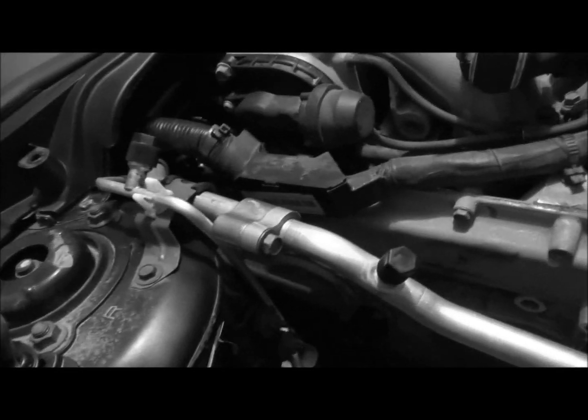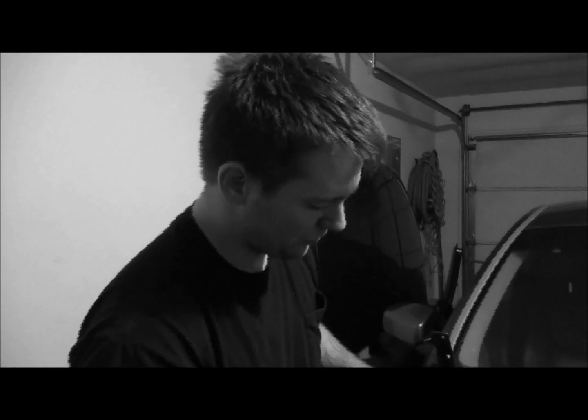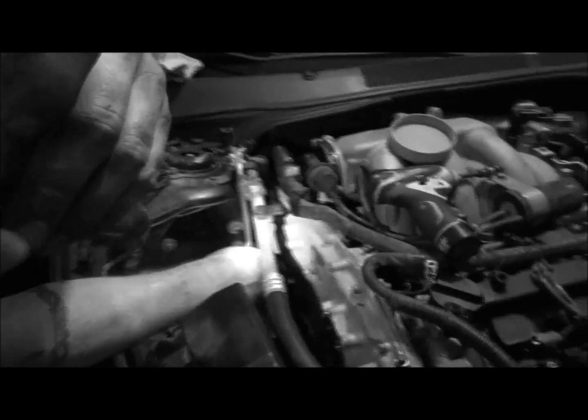So I pulled one off to see what was going on with it, and now that I've got it off, I have Michael here, I'm going to let him video me taking the other one off so that you can get an idea of how this works. Like I said, I want you to do it in the reverse order of the tightening method. It's basically a star pattern, and we're just going to start with a reverse star pattern on this one, and they want you to do the farther out one.